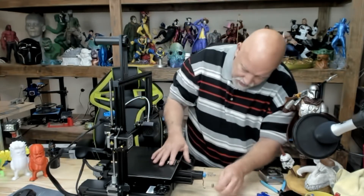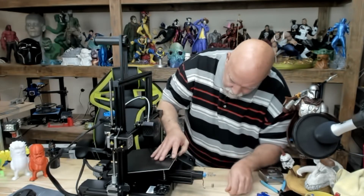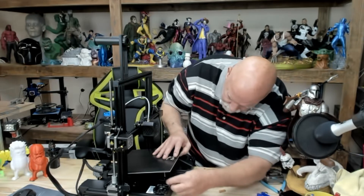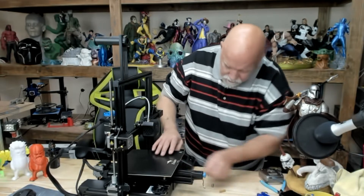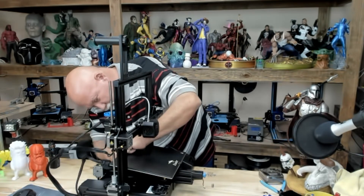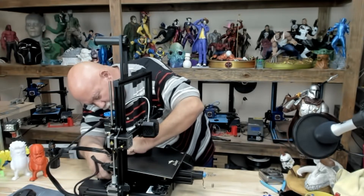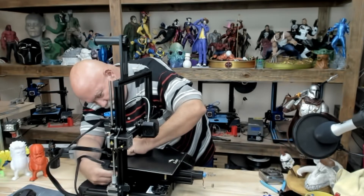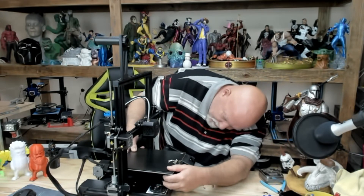Getting past that, simply set a yellow spring underneath each bolt. Sometimes this can be a little tricky when you get to the third and fourth ones. Lift up just high enough that you can get the yellow spring on. Sometimes they'll fall off, and if that happens, no biggie — just give it a minute and put them back on. Once you get all four in place, just slide them around and each bolt will drop back down in the hole.